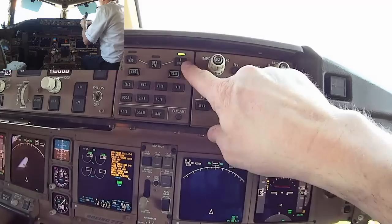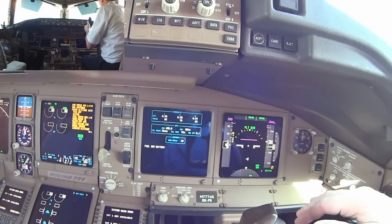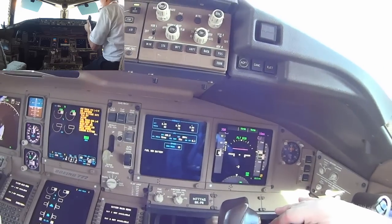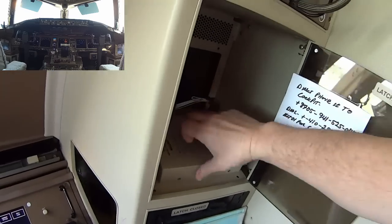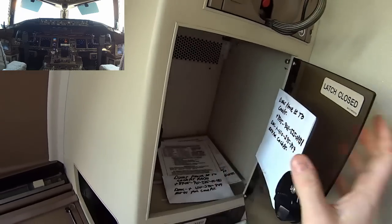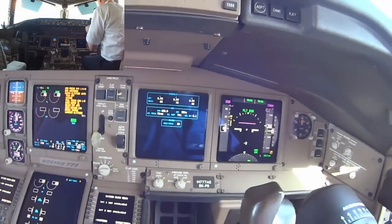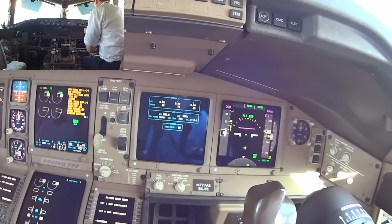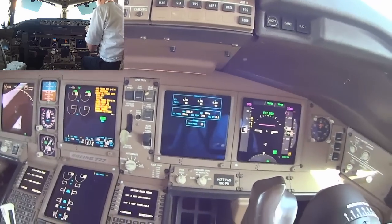I'm on the right inboard display and I want to show my current status to check how things are doing. The fuel shutoff valve battery needs attention — that's what the message is indicating. So I'm going to disconnect that battery during parking times and then reconnect it. Now the message is cleared. This is what you want it to look like on preflight — no messages means no problems indicated by the data bus, and the airplane has done all its checks and says it's ready to go.